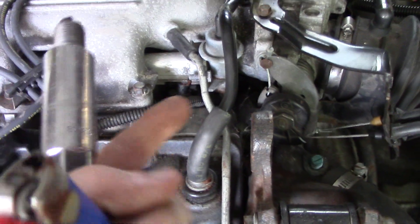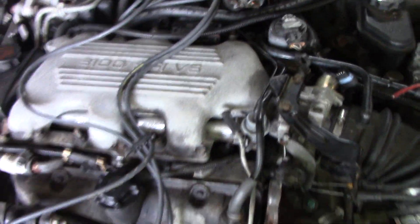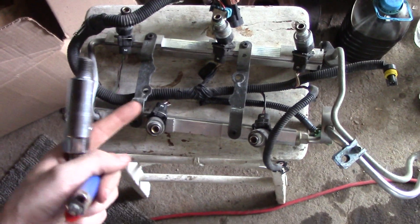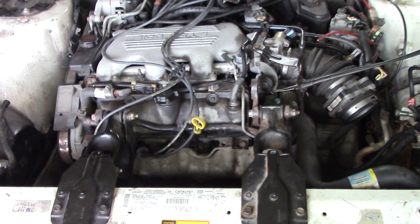That result means this very well could be a head gasket leak affecting that cylinder. If it were gasoline we should have seen a poof from the fuel igniting, but instead it stayed wet from what I believe is antifreeze leaking onto that spark plug. The final confirmation step is to pull the top of the intake off, remove the throttle body, and check or swap that injector. I also have a spare low-mileage fuel injector rail that was saved for my parents' Lumina — I could swap in one of those injectors. If the car still misfires after the swap, I'll know for a fact this engine has a head gasket leak.